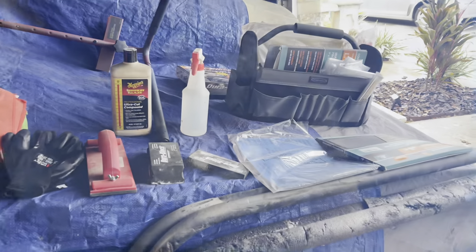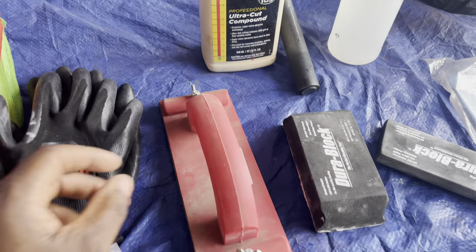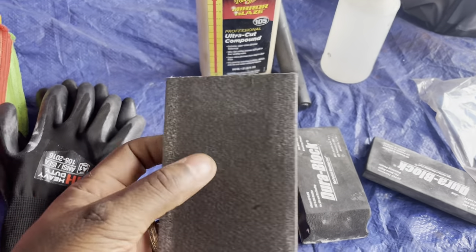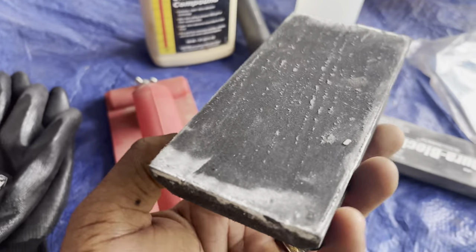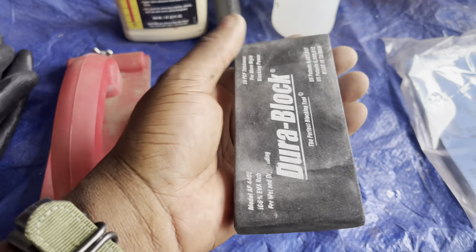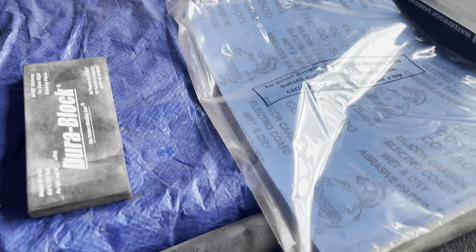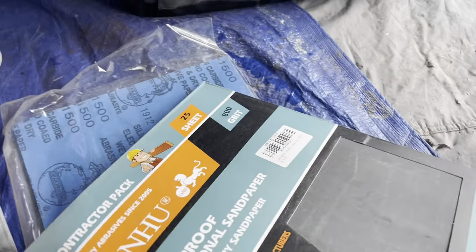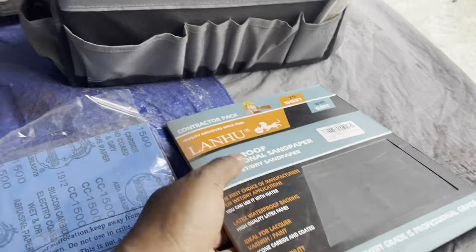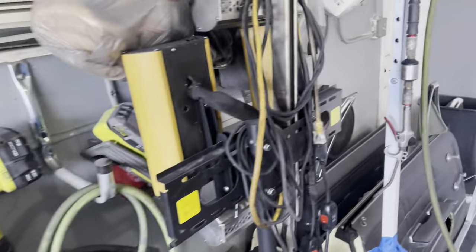There is room for correction with a little bit of buffing, and that's what we're going to do today. We have our basic prep material for the buffing process. We have a sanding stick — I like this because it's flat and has two screw-ins that hold the sandpaper in place without a sticky side. This is our Meguiar compound, a spray bottle of water, and we'll be going with 1500 grit sandpaper. I also have an 800 grit if I want to get a little more aggressive.